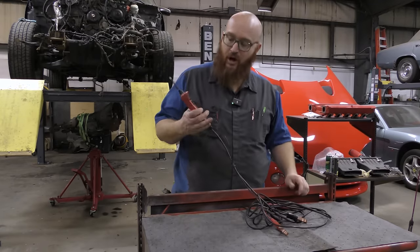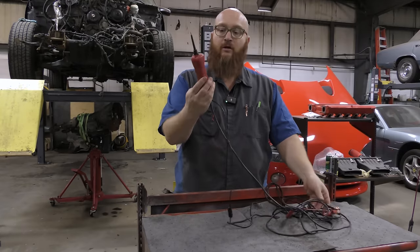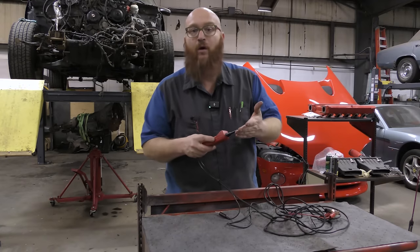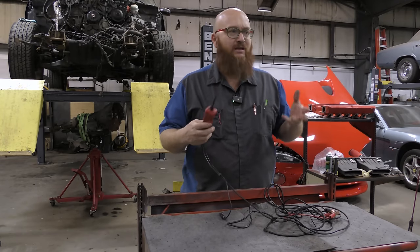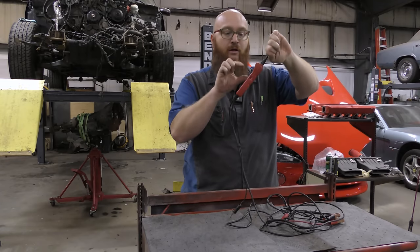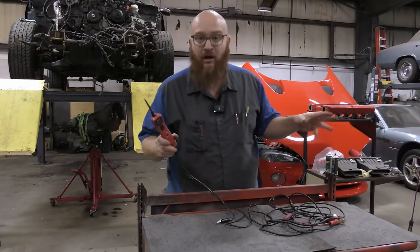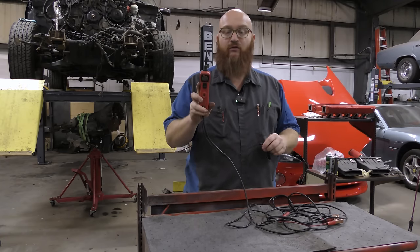The sixth one you've seen me use in the shop is a power probe. You connect the two leads to a battery, and then this little handle has a button. For electrical testing, you can give something power or give it a ground, or just touch it to test if there's power or ground — it makes beeping noises, kind of like R2-D2. If we're wondering if a blower motor is any good, I grab the power probe, back-probe the connector, give it power, the motor comes on, and we've just eliminated that. It cuts the BS — no guessing. You go down the line: this is good, that's bad, and pretty soon you've found the problem, saving hours of diagnostic time.